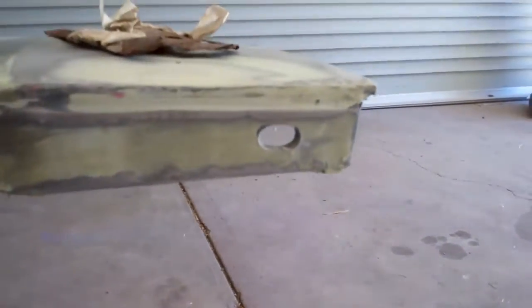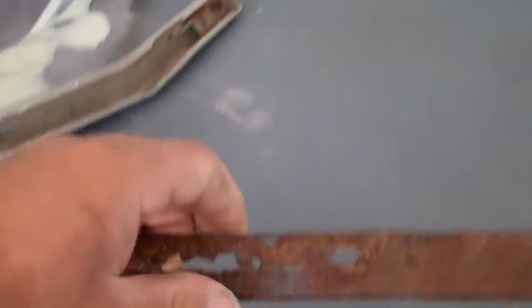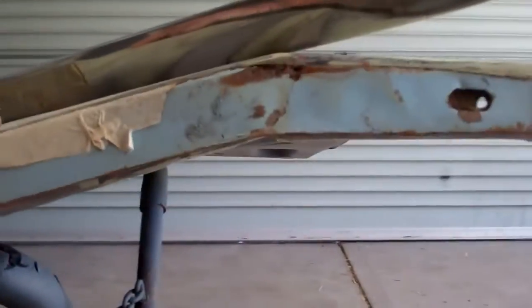The slots are all cleaned out — I've put a round file in there and made those all nice and oval shaped. The chrome trims have got this sort of retaining device on the back. I'm going to make something myself where I can put a very narrow bolt through there, feed it through the slot and bolt it on the other side, because what it originally had were small clasps that just twisted onto the end of a sprig. I'm going to put on something more secure, and I'm going to put a rubber gasket around here so it bites against the panel and stops any water getting in. This was the outer piece and I've also had to replace the inner piece to that as well, so there's a lot of metal that's been replaced in there.